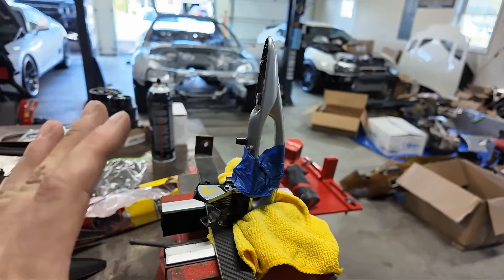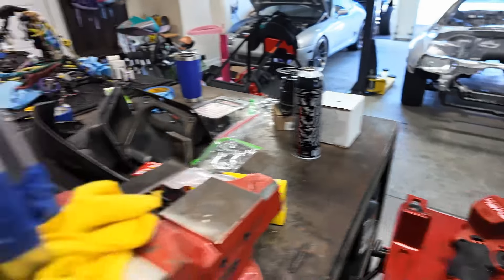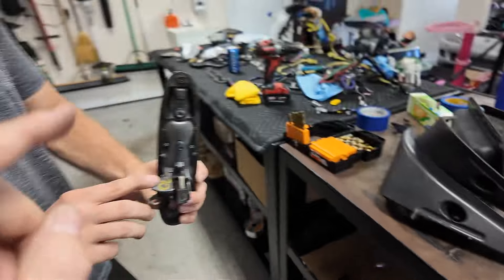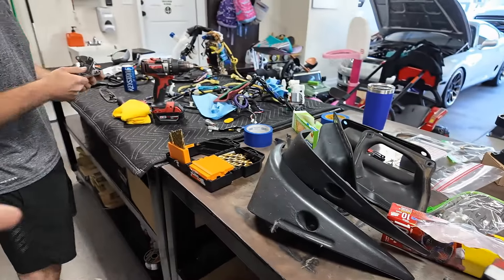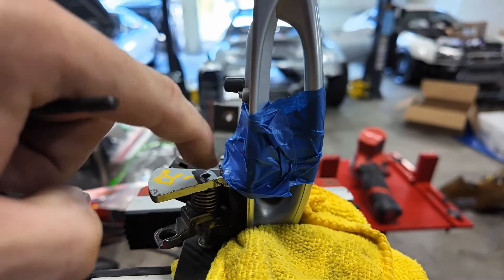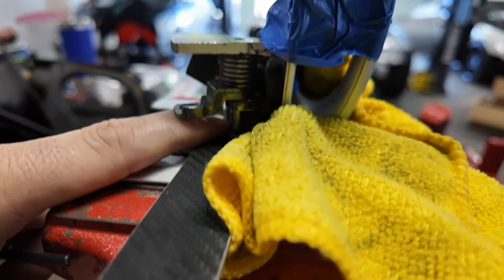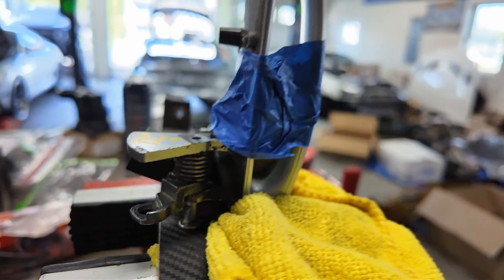We took the plastic off now. This is something 99% of people don't or won't do, but what we did is ground this down. I've got this little Milwaukee tool and used it as a grinder. I put black marker around to make sure I didn't hit anything. It has a solid pin - it's pressed in, now it is pushed out. We literally used a punch and went in here and pushed it out. We put a plate under it to give it rigidity, clamped it in with a rag, and then pushed the pin out. We're gonna have to tap this side and then use blue Loctite or something to hold it.